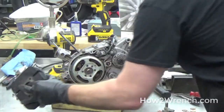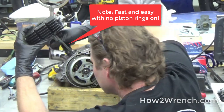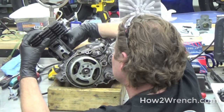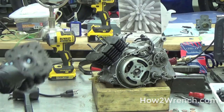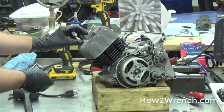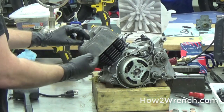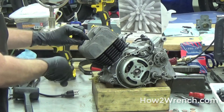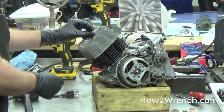So let me show you what I would do. We're going to back up a couple of steps and start by slipping the cylinder on — this can actually be done a lot faster and easier if your piston rings are off. I'm going to go ahead and put the head on. I don't need gaskets or anything, I'm not going to be cranking anything down, but the whole point of doing it this way is that the piston is completely supported. I won't break a skirt, I can't hurt anything — we're trying to protect parts.